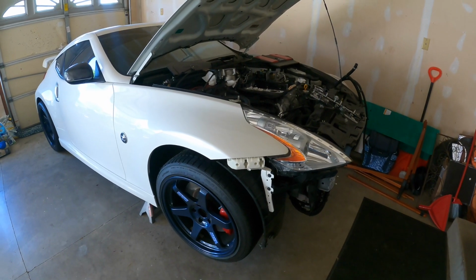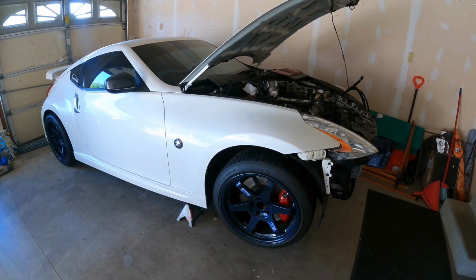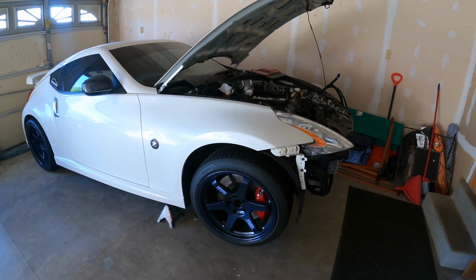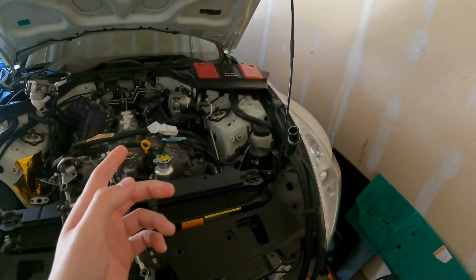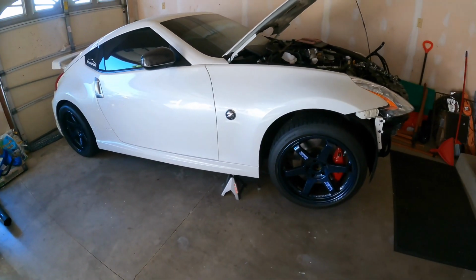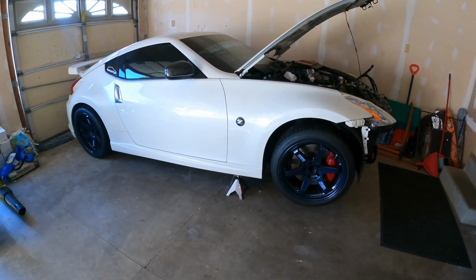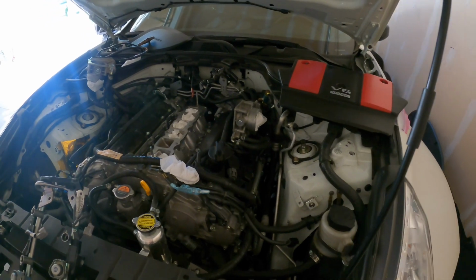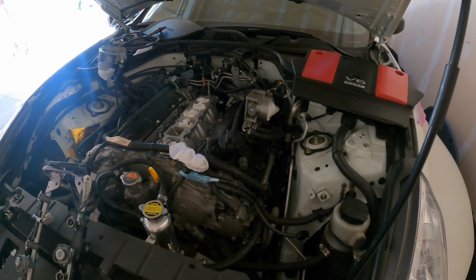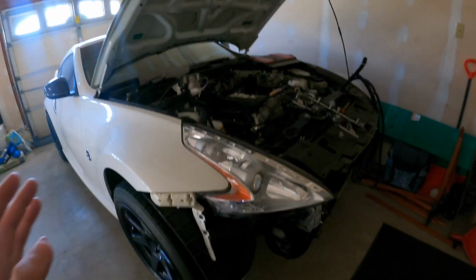We never got a good dyno pass out of it. We're assuming it made around 700 wheel horsepower. It went 60 to 130 in 6.4 seconds, which is right around the 700 wheel range. But that's where we're switching up from this point on. And it had the Z-Speed Stage 4 6-puck clutch in it, South Bend flywheel, stock trans. Got a little bit bored with that, so we're gonna up the ante and try to hit that 1,000 wheel mark.